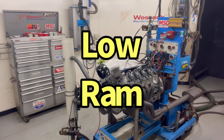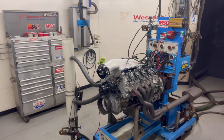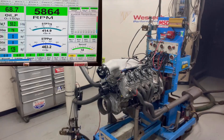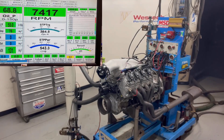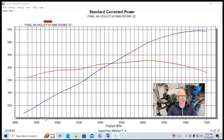Let's make some runs. Let's jump right in on the results of our sibling rivalry — we got Holley on Holley action here, High Ram versus the Low Ram. Before we get to the results, you can kind of see what's going on with the High Ram — we're up near 550 horsepower, so it's pretty good. But we need to talk a little bit first about why these two intake manifolds would be chosen for this kind of combination. We went over what this motor was — it was a junkyard 5.3 — but why these short-runner intake manifolds would be such a good combination with this particular 5.3.